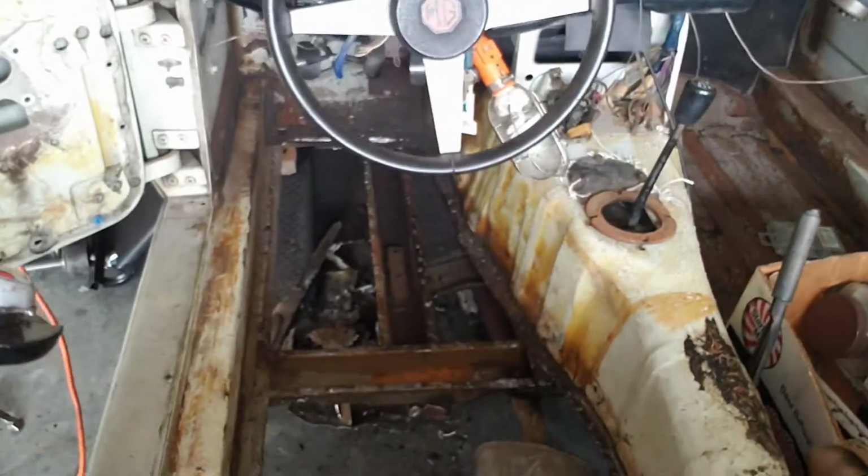All I could find was my wife's Hear Pro, so I've got pink on, but we're gonna clean it up and see what we got, and I think I might be done. We'll cut out the section to weld on the end there. It's not super pretty at the end, but I think I got the rust out. I might use some tin snips to clean it up a little more, but yeah, we're gonna take the wire brush and scrub her down and get it prepped for welding.